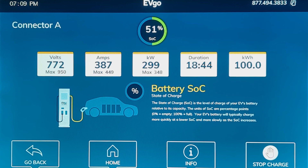The Silverado reaches 60% state of charge in 23 minutes, but now we're only taking in 217 kilowatts. We hit 70% state of charge 9 minutes later at the 32-minute mark, and the charging rate is down to 163 kilowatts. 80% state of charge comes 8 minutes after that — actually a little faster than 60 to 70% — because the charging rate began to climb back up, peaking at 188 kilowatts. I finished the 10% to 80% charging session in 40 minutes, with the charging station dispensing over 166 kilowatt-hours.